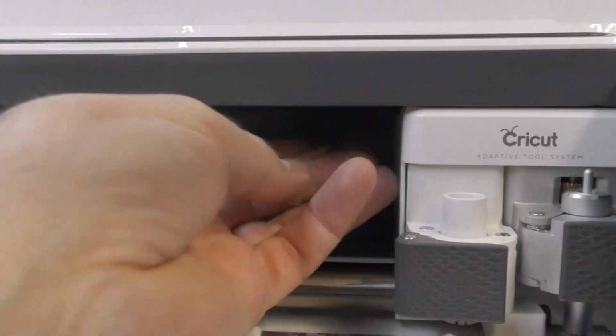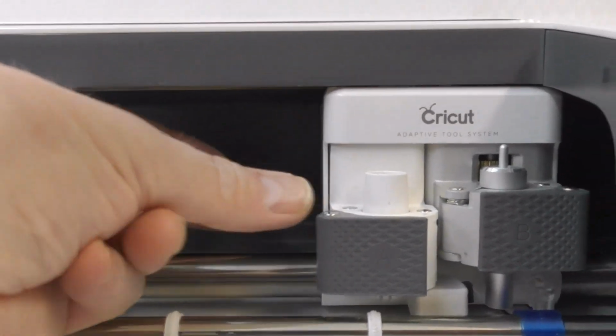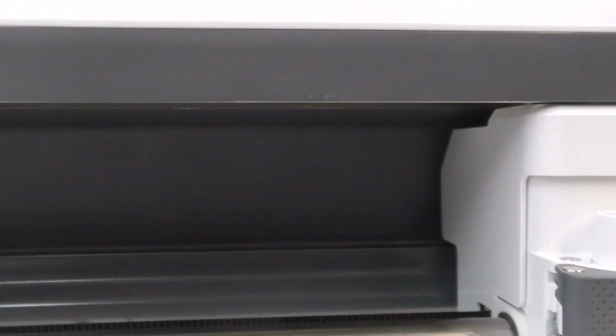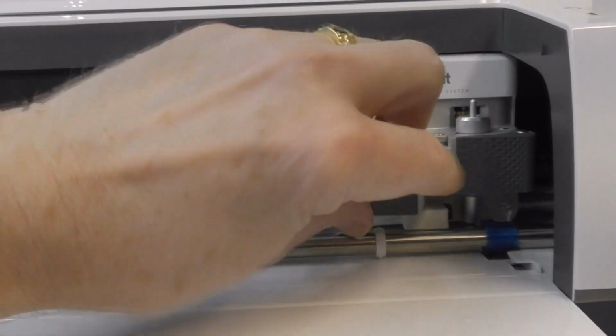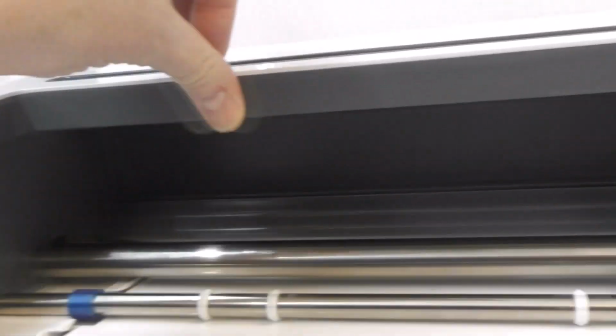If you've got strong fingers, you'll find these small screws will come out with strong finger pressure. You don't need to try and get some stubby little screwdriver in there, or buy some 90-degree wrench or anything like that. Just do it by hand. When you reassemble this, again, you can tighten these up by hand, and if you find that it feels a bit too tight, just back the screw out and start again. It's probably gone in slightly differently and it's trying to cut itself a new thread. So if you can put it into the used thread, you'll be able to do that up by hand.